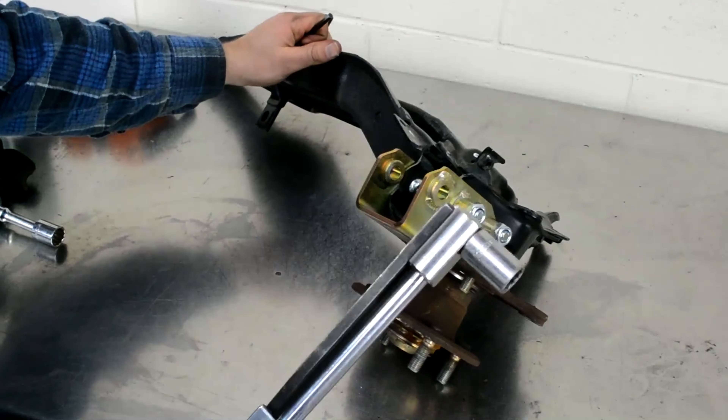The reason I didn't upgrade the intake manifold: when building a circuit car, more power is not always a good thing. This car made almost 230 horsepower. I'd like to detune it to around 190 horsepower — into a turn you don't want too much power, especially given the weight of this vehicle. It's got a regular eBay header going to a three-inch full Thermal exhaust system. I love Thermal exhausts — they sound amazing. I have them on every car I build.